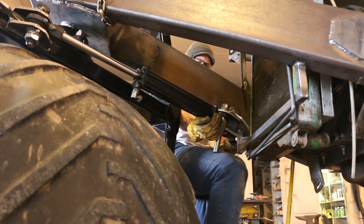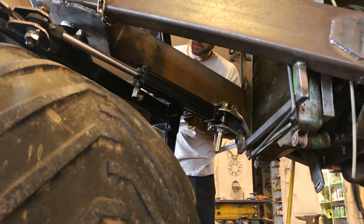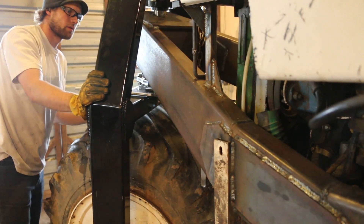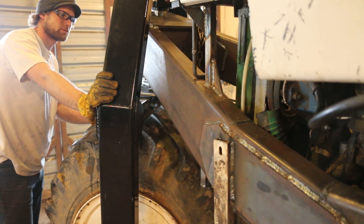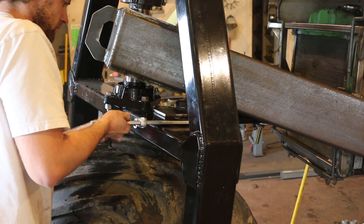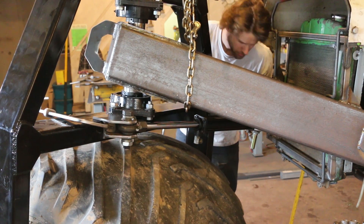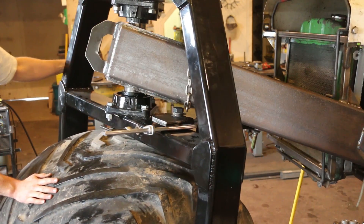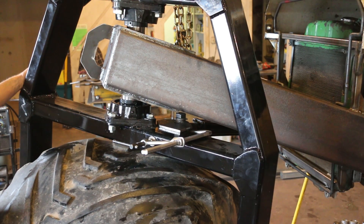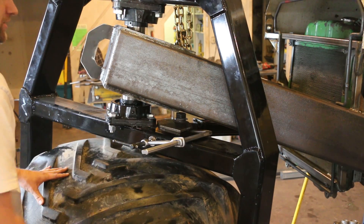With the wheel turned all the way to the right I extended the cylinder as far as it would go, clamped it onto the frame where that matched up, then rotated it around — and just as I expected, it wasn't quite right. It wasn't too bad though; I had about an inch of space between the fork and the frame and I knew I could get it closer than that. I scooted the front mounting point over about a quarter of an inch, repeated the process, and checked it — a little more turn to the right than to the left. That side had about an eighth of an inch, so I kept tweaking. I think moving this out a little bit changes it quite a bit.